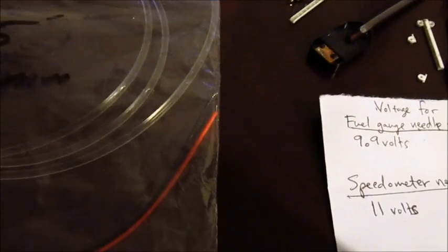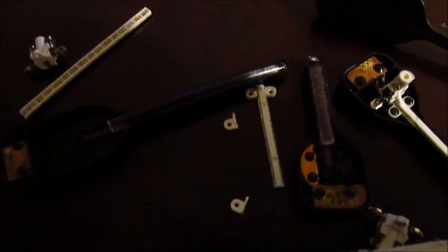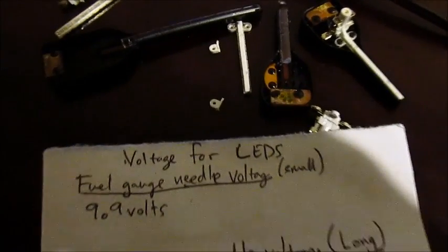Okay, that's that option. Oh, and by the way, I have 3 millimeter. 3 millimeter fits, and it kind of widens the plastic a little bit. If you can find a 2 millimeter or 1 millimeter, you'll be golden. Anything smaller than 3 would be awesome. 3, if it's your last resort, go for it. So that's the first easy option to bring your gauge needles back to life.